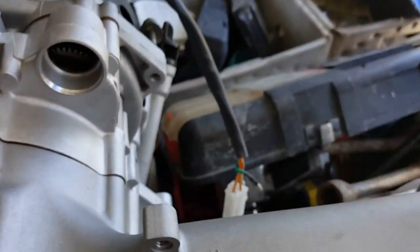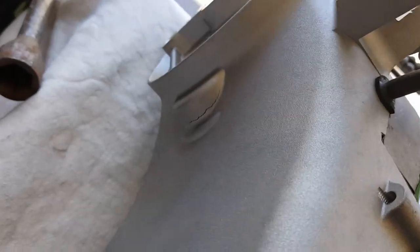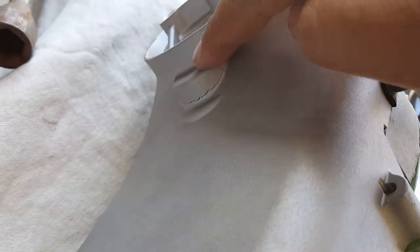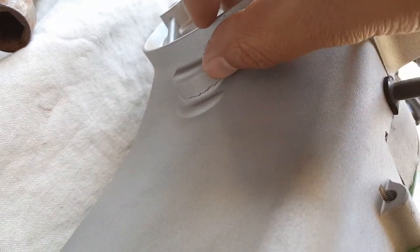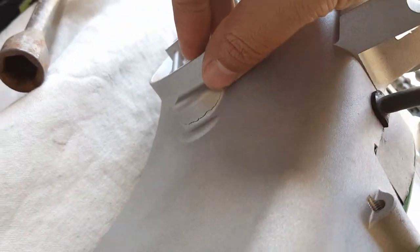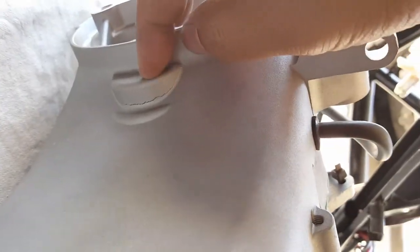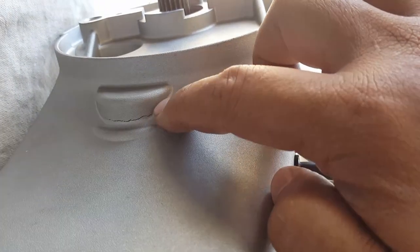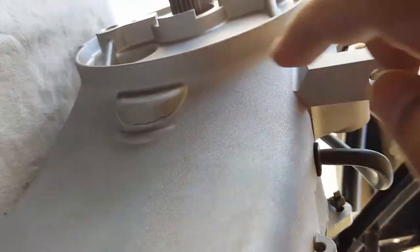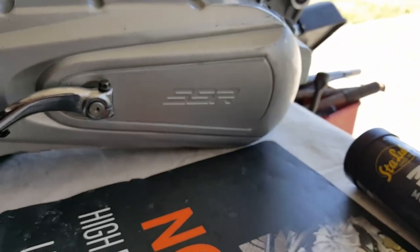Just going to put it. And also discovering that we sealed one, we ended up actually discovering there's a crack here. This is actually where the bearings was. I think when we kind of forced it in there — that's why you don't want to force things in there. Unfortunately we did and this is the result we got from it. What we can do, since it's not fully cracked in, we're going to go ahead and just put it with some weld. And since it's aluminum, it'll melt and pretty much seal itself. We'll deal with that afterwards when we get all the engine parts assembled.